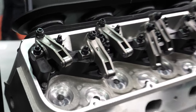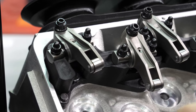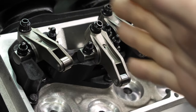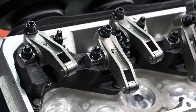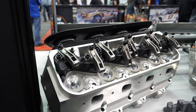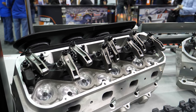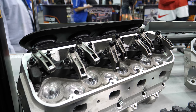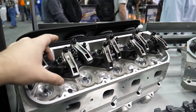The real advantage of the new design is trying to get away from having offset rockers and really improve on geometry, keep everything as co-planar as possible, minimize pushrod angles. And to accomplish that, we have to rotate the rocker on the stand. The other option in the past — you saw a lot of offset rockers where the shafts would be in line. As of right now, this is just a prototype stage. It'll be in production in the next month. We just model it, prototype it in 3D print, and then we can test it for fit, function, and geometry, and then put it into production in steel or aluminum. It looks a lot stiffer when it's just one piece.